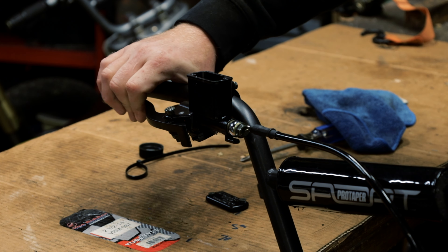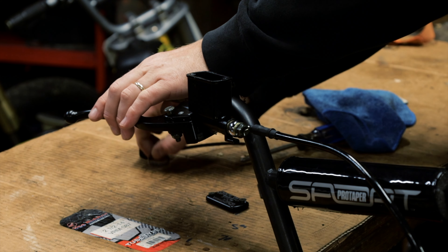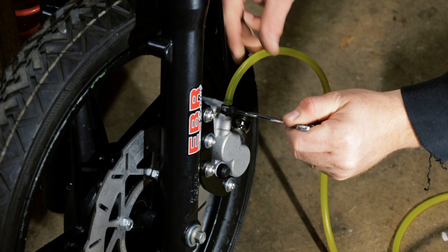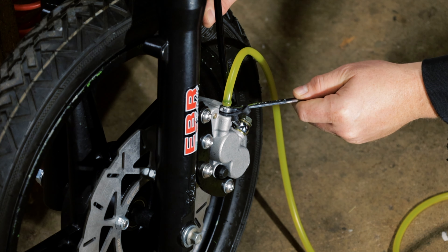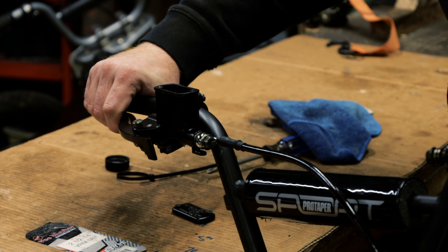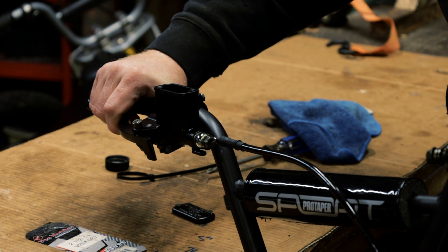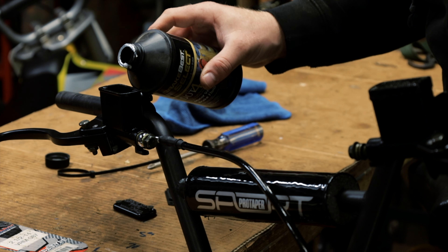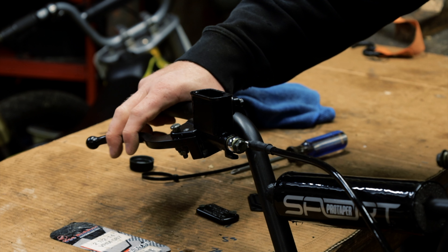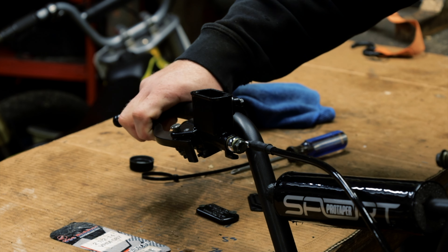It's getting harder to pump — so that's good. Pump it down and put the zip tie on. I have done this about 15 to 20 times now. This time no air bubbles came out. You just want to keep doing this until it becomes firm. Make sure not to run out of fluid up here — top it up because it will start drinking the fluid. I've bled this about 20 times and now they're getting pretty firm. This is about as far as I can pull them back, so that's pretty good.